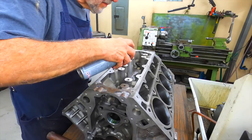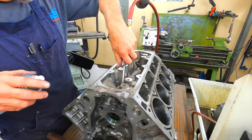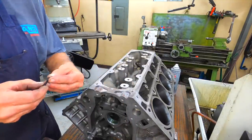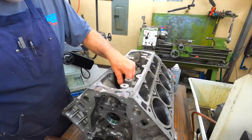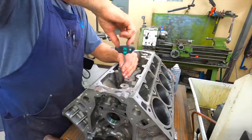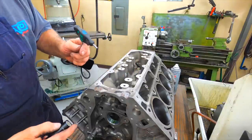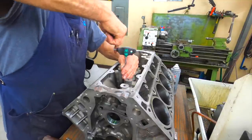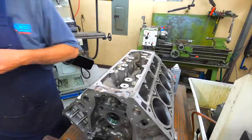Use a little cleaner to get all the cutting oil, chips, and stuff out of the threads. Then just an Allen screw — sometimes it takes one washer, sometimes two. You just have to check it and see. Different year blocks vary a little bit. I could grind the bolts off, but I've just found it easier to add a washer — it doesn't hurt anything.